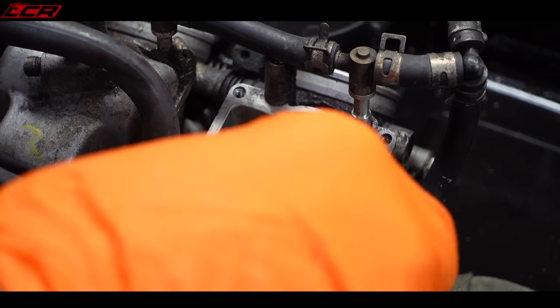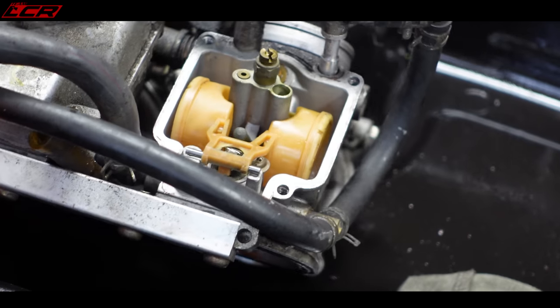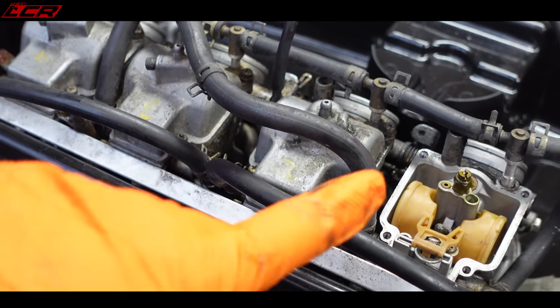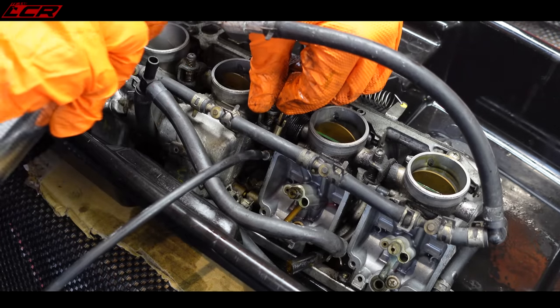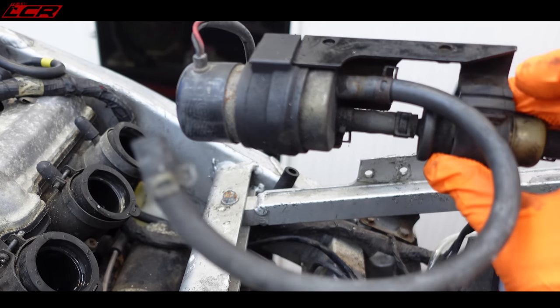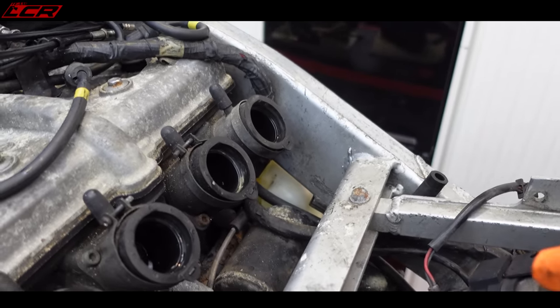I've decided I'm just going to spray everything out, make sure there are no blocked holes, and get these professionally cleaned and rebuilt later. I've squirted cleaner into the main jet and you can see it coming out of the carb — so that's definitely clear. I'll do the same for each of the other carbs and then bolt them back on. Carbs are now clean and ready to go back on. There's also what looks like a fuel pump and filter here — I'm surprised the bike has a fuel pump; I thought it was just gravity fed.